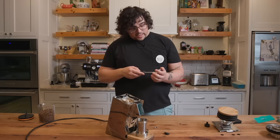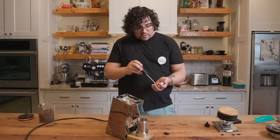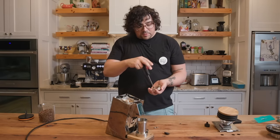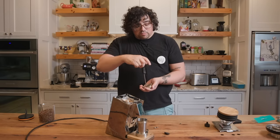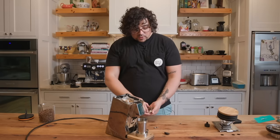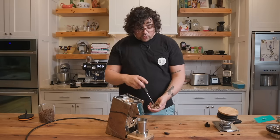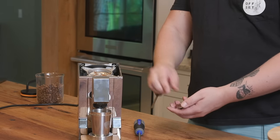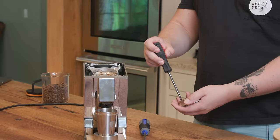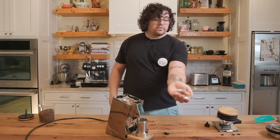SSP burrs at 64.2mm do not fit, and even Hansung's second-run Cast burrs at 64.1mm still don't fit. Not only are these not 65mm, they are smaller than SSP's 64mm burrs. There is also some retention underneath the burr carrier — there's a gap under the burr that I wish came up a little higher so coffee wouldn't get underneath.